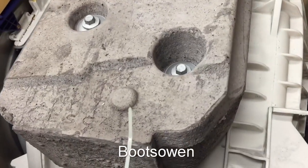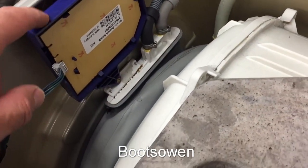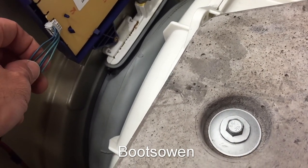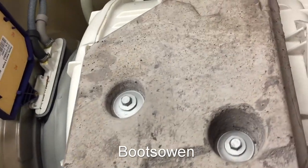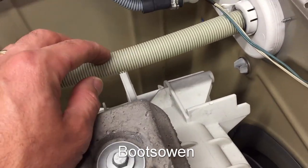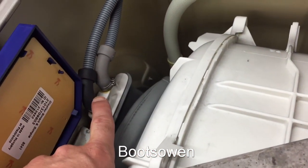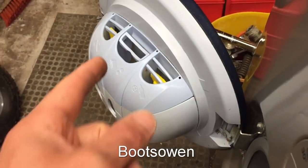With the top off, there's very little going on in here because there's no soap drawer. It's got the user interface here — a PCB with a data connection, four or five cables. A lot of machines have that nowadays, going down to a PCB below, similar to all the Indesits and Whirlpools with this plug feature which I guess is for servicing the machine. I think this is just a breather tube coming out to where the hot fill should be, going over to the front of the tub. Water comes in through two solenoids, dosing to one or the other or both.